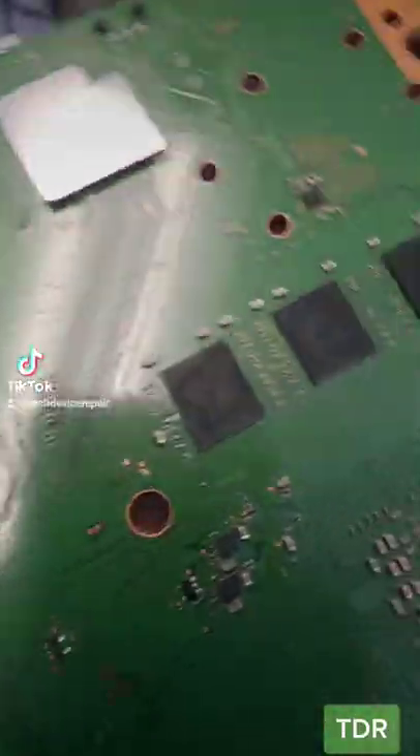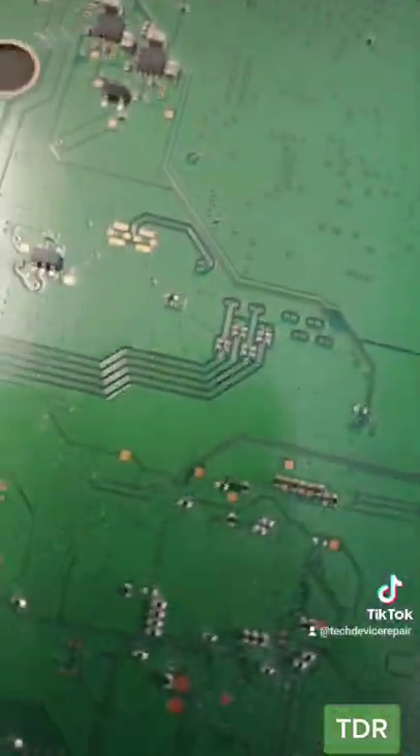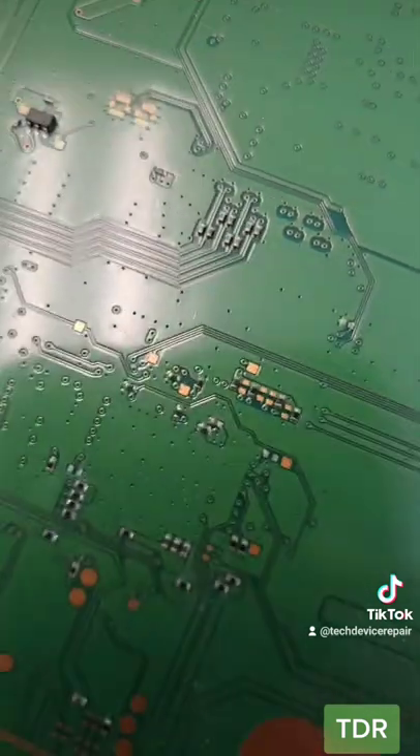I put in the used but working fan and it's still not spinning. It spins a little bit in the beginning but then stops. It has to be motherboard damage. I did a physical inspection and check this out — there's a resistor missing and two capacitors knocked off. Let's go fix those.